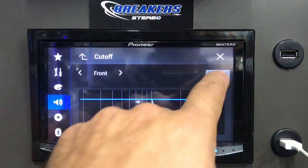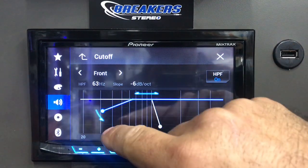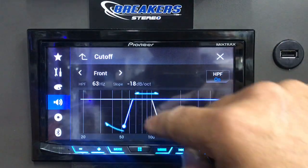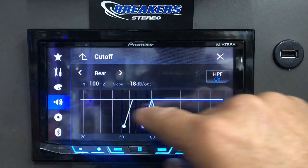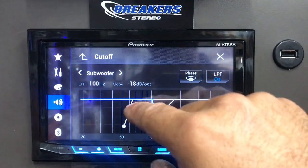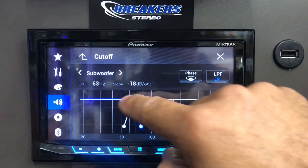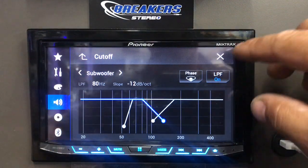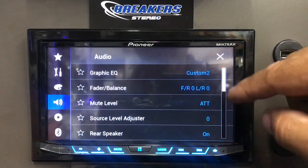Let's turn it on and check how it works. That's the front — we're going 63Hz and you can select the slope. You can also select the rear the same way. For the rear, turn it on and put the frequency you want to cut off — let's say 160Hz at 12dB. On the subwoofer, let's say we want it at 80Hz — that's normally where we set it — at 12dB. If you do have an amplifier, it gives you the ability to control it at the radio as opposed to at the amplifier.